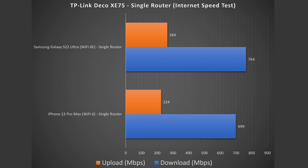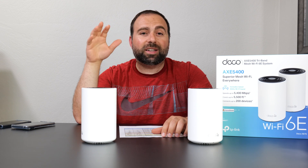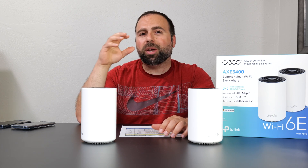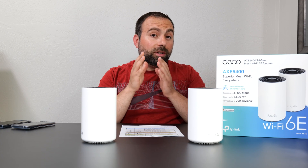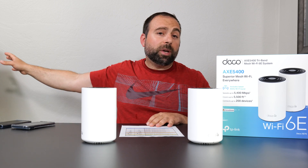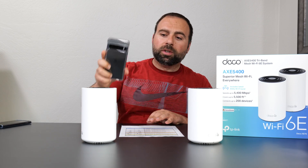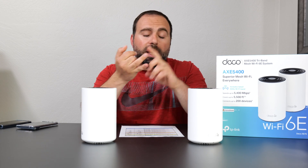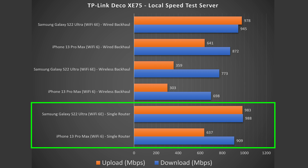With the Wi-Fi devices, we get very good download speeds but the upload speeds do suffer — and the same is true for the Wi-Fi 6E devices. This is pretty typical with all the mesh Wi-Fi and routers I test. That's one of the reasons I do local speed tests: I make my computer into a speed test server and go from phone to router to computer, isolating the router and getting rid of ISP and public speed test server fluctuations.